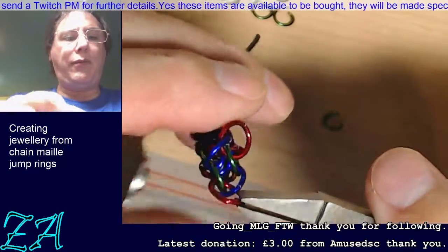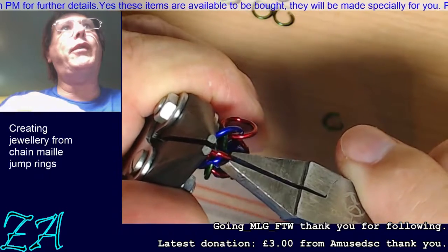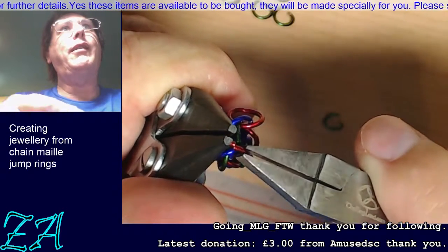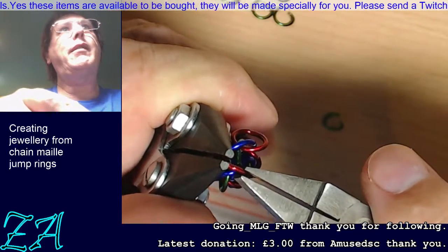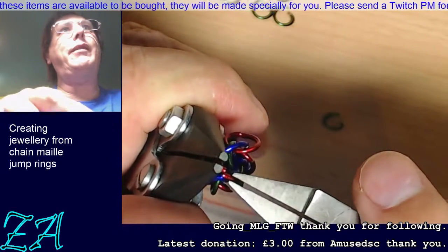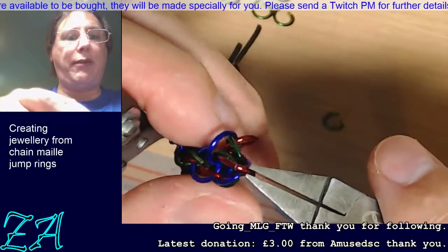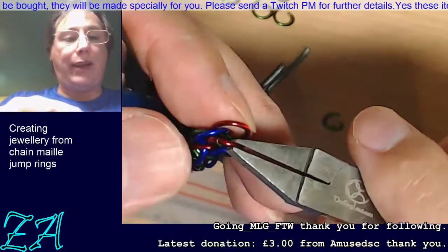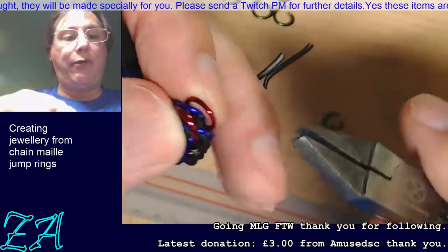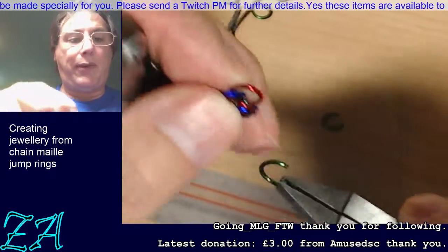But these rings have a memory type effect, and like this one which was closed, it's got a very slight twist on it. So I just need to tweak it a little bit to make it sit back in the ideal position. And probably over another hour, or even the next 10 minutes, it's going to move again a little bit. So I'm going to have to go over it again and just put the rings back into position again.